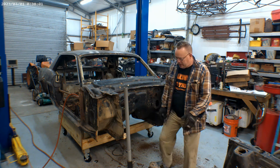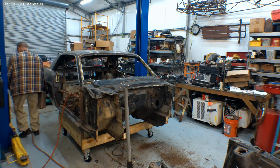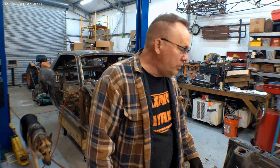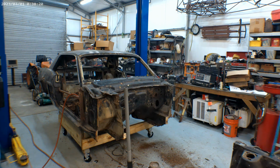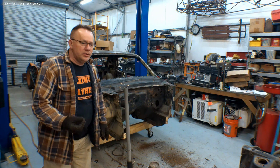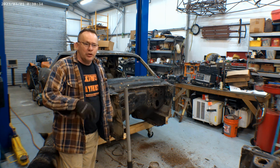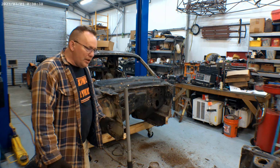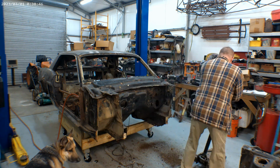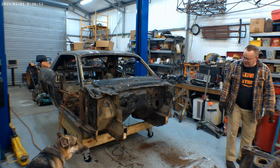Well, the monitor went to sleep. And yes, the air compressor does cycle. There's a bleed set up on the bottom of the air compressor so the water from the tank can drain out and go outside. So it loses air slowly to blow that water out. Not a big deal, but makes the air compressor run a lot. Just in case y'all had questions about that noise.